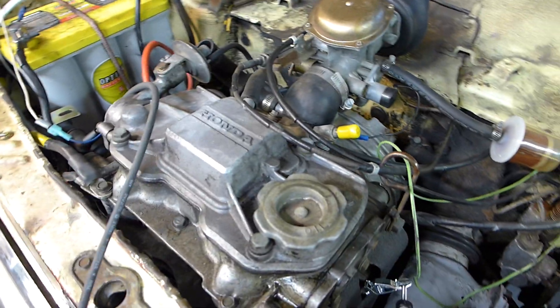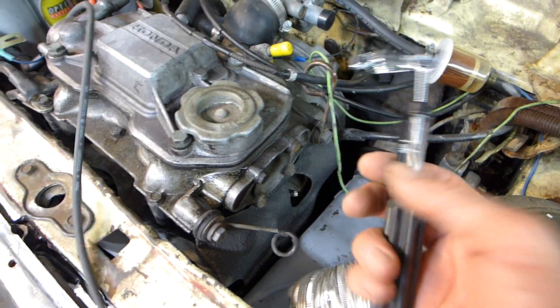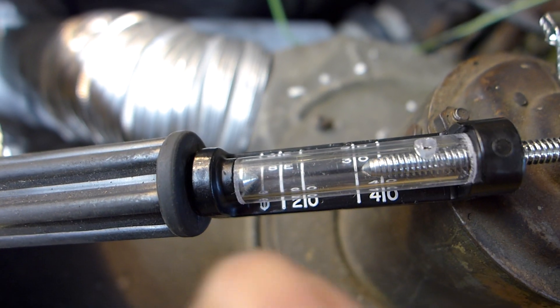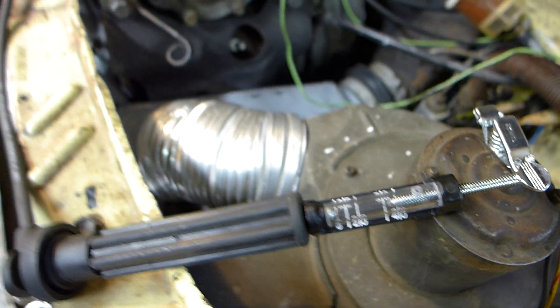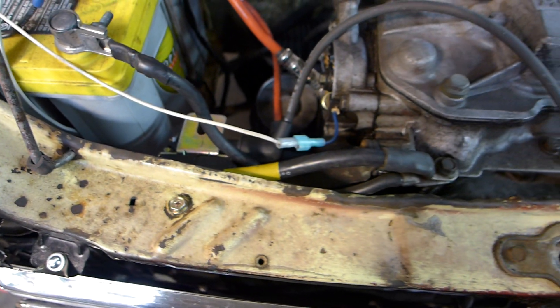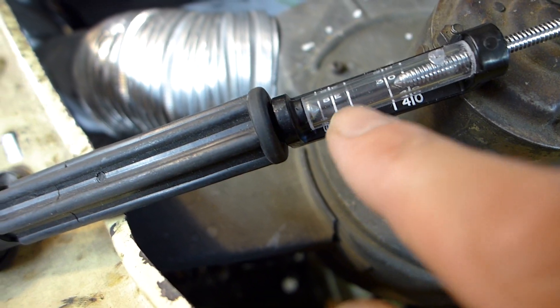That's the point of my video here today. I have this cool little tool — it's an ignition coil tester. If you look at this little glass sight on here, there's a metal pin on this side and a metal pin on this side, and this is a threaded tip you can screw in and out to adjust the gap of the spark. The Honda 600 came with what's called a double pole coil, bolted underneath what would be the radiator core support, with old-fashioned points and a condenser. The ignition system was rated — I measured mine at about 15,000 volts, which is that first mark right there.